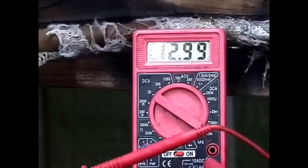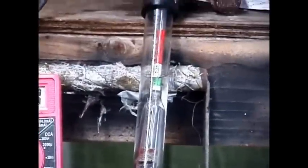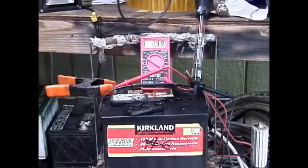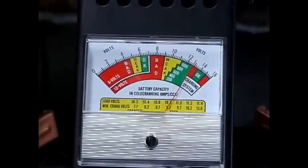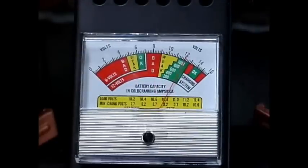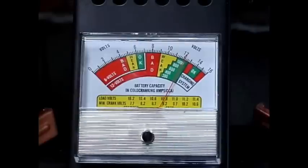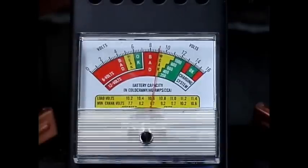It's been sitting for several days and hasn't dropped below that, which is pretty good. But voltage doesn't mean everything — the hydrometer shows the level is just in the green, which is also pretty good. Now checking the cold cranking amp draw: it's close to 13 volts, but when I put the draw on it, it goes down to 200. Two hundred cold cranking amps is not going to start a car. If the capacity isn't there, it won't start a car — you need about 600 cold cranking amps to start the car.